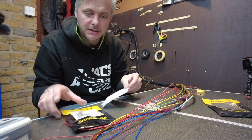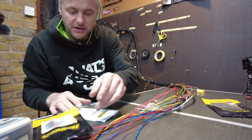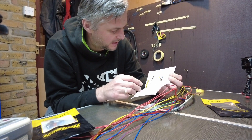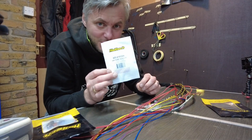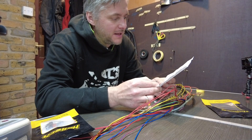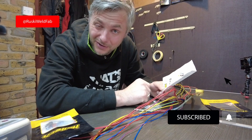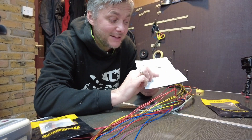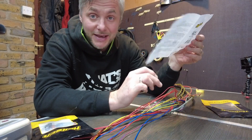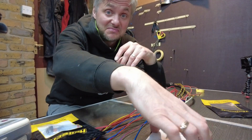All of the sensors I'm using, I'd say 90% Haltech. The majority of them are not actually made by Haltech — they're resold by Haltech, most likely made by Bosch. The cool thing is it comes with instructions, because if you search online instructions are usually sporadic and conflicting. It also comes with a calibration chart, so you literally just put this into your ECU and you know it's going to be 100%. You remember last time when I was calibrating? That took me a couple of hours. Not with this.